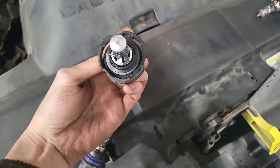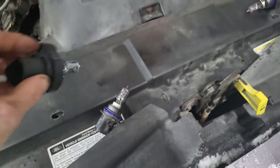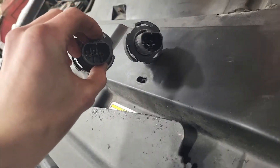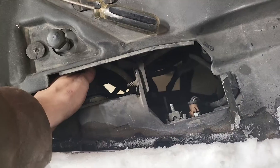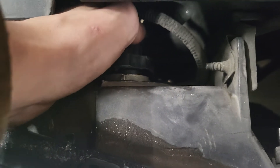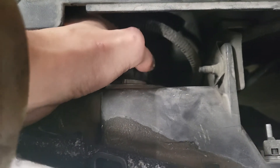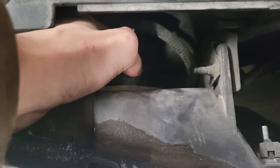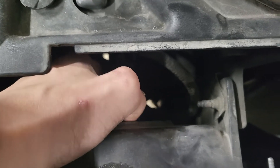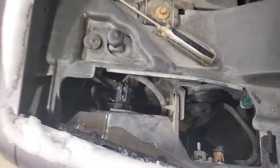There you go. You do the same thing with the other one and stick it in. I want to make sure these are the right ones — yeah, it looks pretty close, it should work. Once you have it in, all you do to put it on is see that little rubber ring right there? You just stick that into the housing and the bulb just sort of stays in there — that seals it. Then put your retainer ring on and turn it clockwise, towards the left, until it won't turn anymore. Give the bulb a good tug and there you go — one headlight installed.